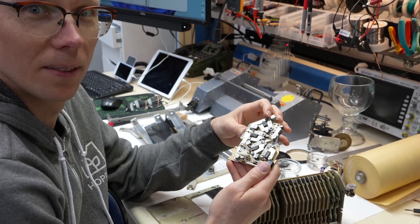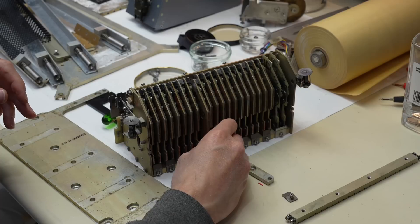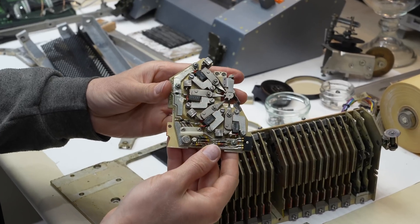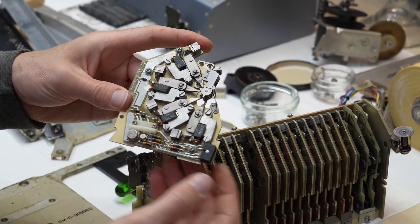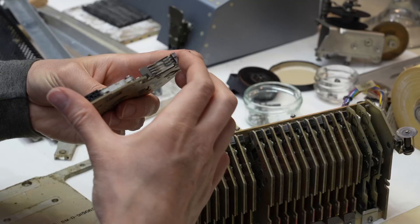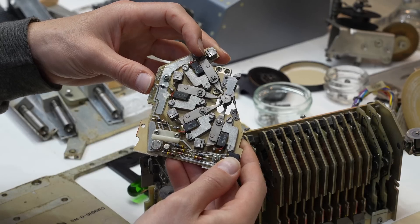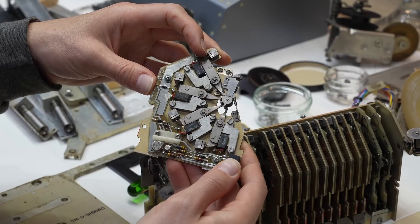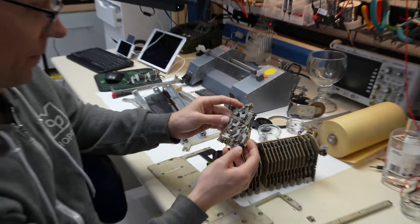Our boy Eric has taken one of the hammer assemblies out — you pull it out and have that beauty. Are those stuck? Yeah, they're still stuck — the two hammers in the middle are jammed. So you have five hammers per cassette, and it looks like there are four of them. They don't move very much, so we'll have to realign. There's a very precise spec on how far they have to be.